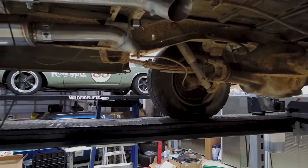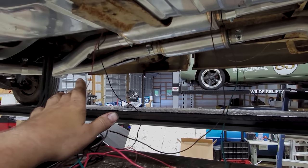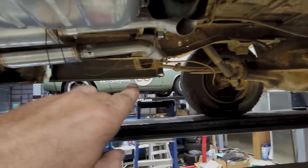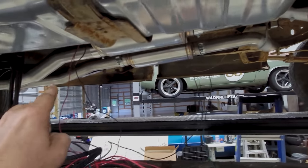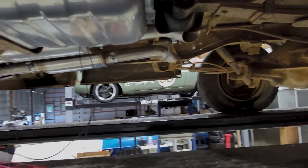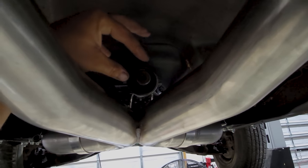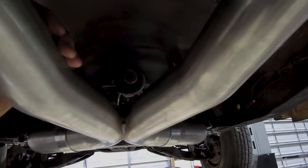Now, every shop's a little bit different, but I've been pretty lucky getting away with three basic measurements. Well, I guess technically four. One is from the output shaft seal all the way down to the center of the U-joint. And then we go from the end of the output shaft all the way down to the center of the U-joint. And the third one, I like to give them this depth measurement between the seal and the shaft here. I'm going to stick a pick in there, mark it, pull it out, and measure that. So they know how much shaft play can go into this puppy, right? Because I got to take that into account too.